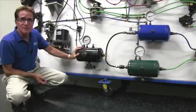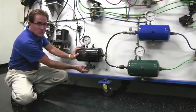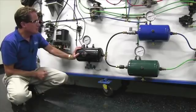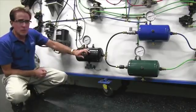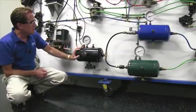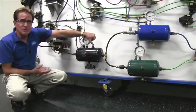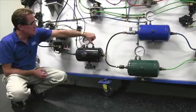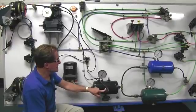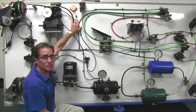That's where most of the moisture collected. To get rid of that moisture, all reservoirs are required to have a manual means of draining. Also found on the wet tank in this demo is the low air warning switch and a pop-off safety valve. The pop-off safety valve is an industry standard — it will open and relieve pressure if it builds over 150 PSI.